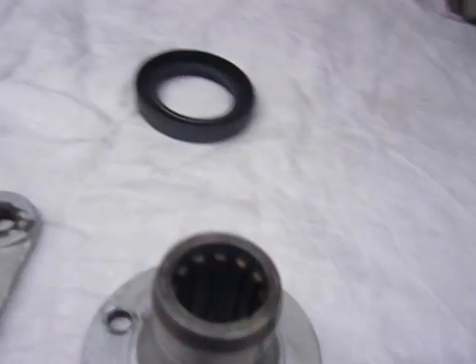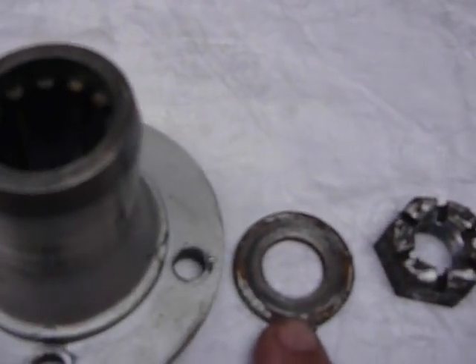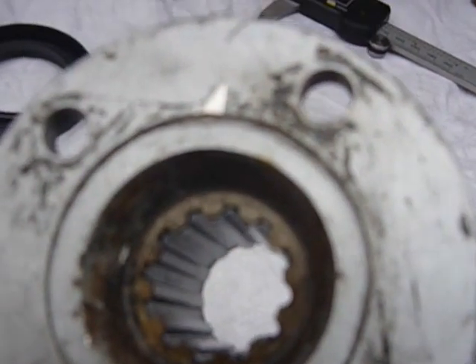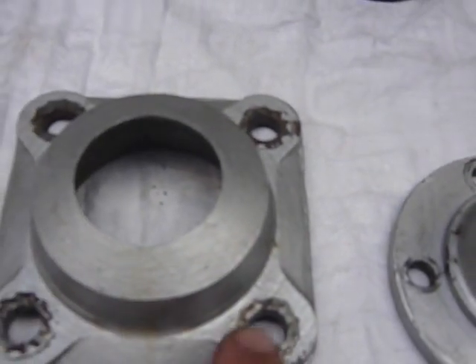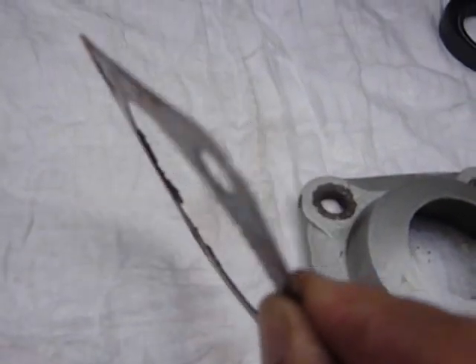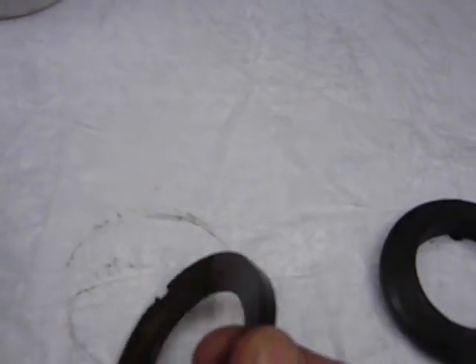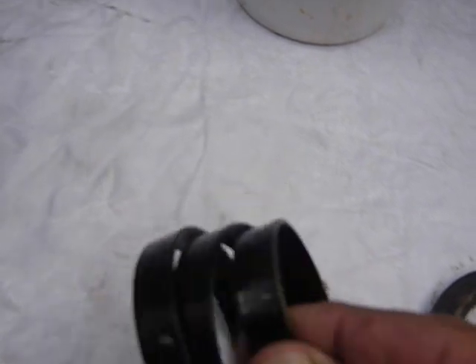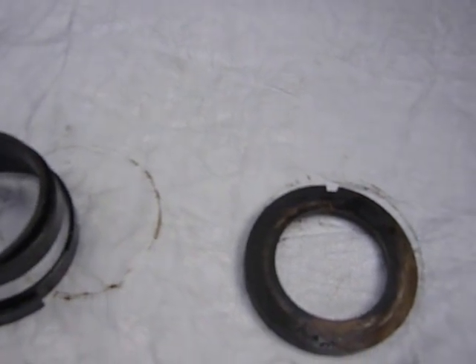I've laid the parts out so you can see them. There was a split pin holding this big nut, and under the big nut there's a washer. After that, the next piece will shoot off when you undo the four bolts because there's a huge spring behind it. There's a flat mesh metal washer — quite thin — keep that to go back. We then have the old oil seal, which is made of a fabric material. This compresses the seal, and it's all done by the big spring which puts pressure on everything and, as I said, can fire the whole lot onto the floor and take you by surprise.